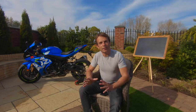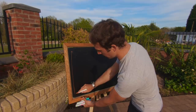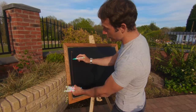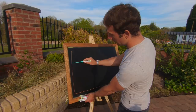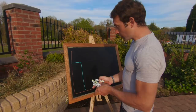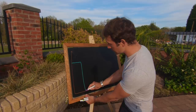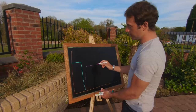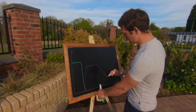I'm going to show you on the board what it looks like on the data. Every MotoGP rider is very similar in that first phase. On the axes, we have forces and time or distance. So, the gas: we arrive on the straight at 100%, and as soon as we hit the braking marker, the gas is rolled off very quickly — absolutely to limit the neutral phase. Then we've got the front brake, which comes up quite fast and stays at a maximum of about 12 bars in the system. Then, as we start tipping into the corner, the front brake trails off really smoothly until the end.